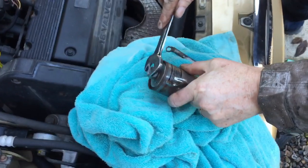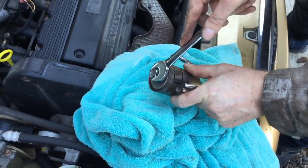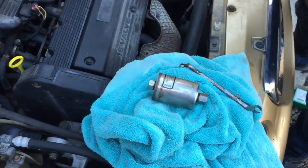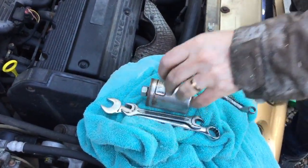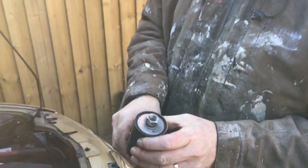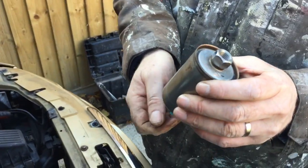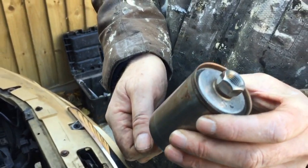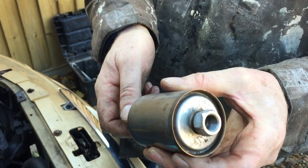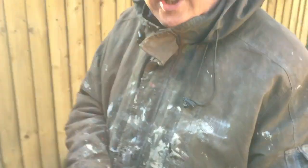When popping it back in, take your old one out, slide the new one back into the bracket at the bottom and top position, and do it up finger tight. The reason to do it finger tight first is so you know you haven't cross-threaded it — when you've done it as tight as you can with your fingers, just put your spanners back on.